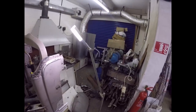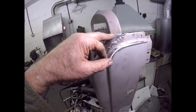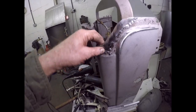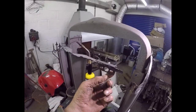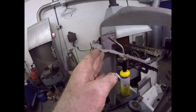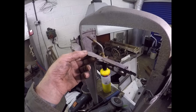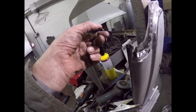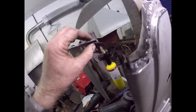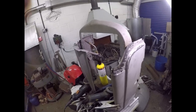Aided by my trusty floodlight — that's the first piece tacked in. We've built that edge back up and now have something to weld to; we may have to trim this slightly round there. The next bit is to get a piece made for here — it wants to come out to here, so I'll make it big and trim to fit. It needs to go straight across there and round, ending somewhere under the top of the cowl. It appears that's not welded on very well or has moved — never mind, we can do something with that.